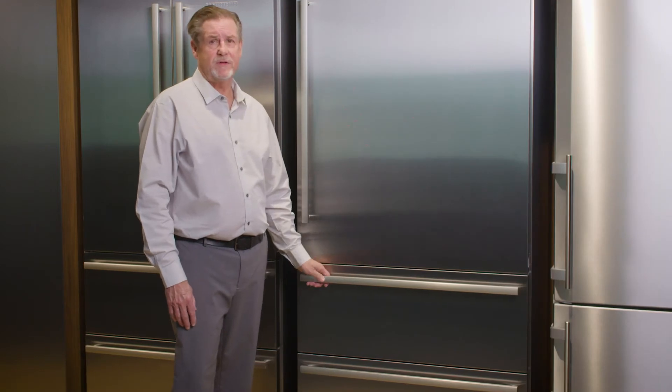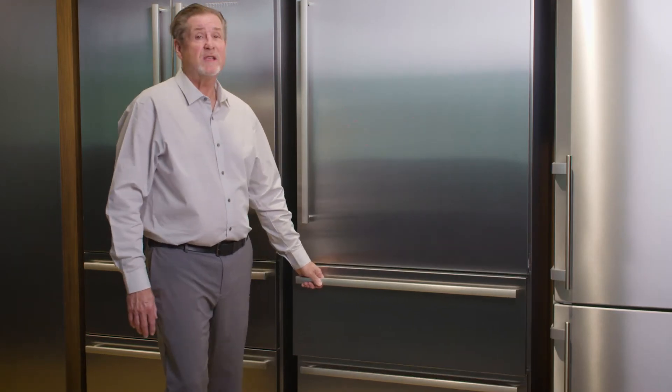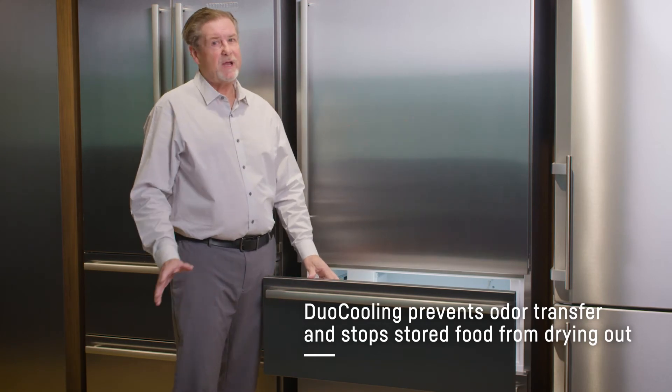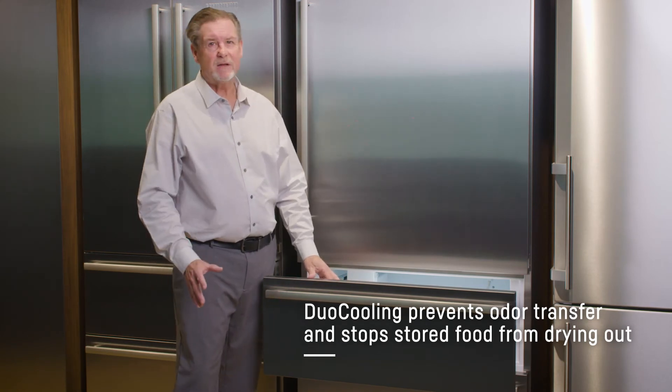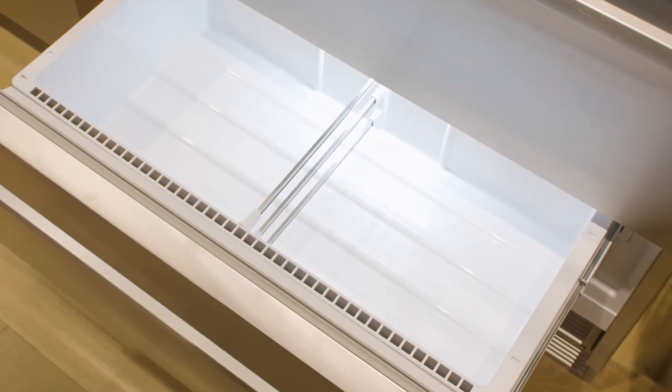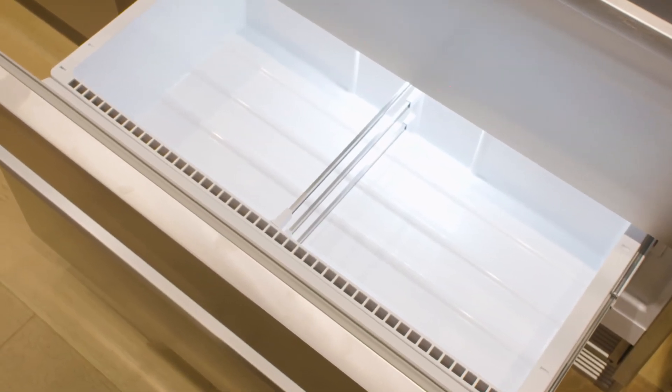What's the benefit on the freezer side? Well, one, we're not transferring flavors from the food compartment down into the freezer, which might have a negative impact on your ice. And secondly, when you do transfer the air between the two compartments, you're using the freezer as your general tool to cool the food compartment.